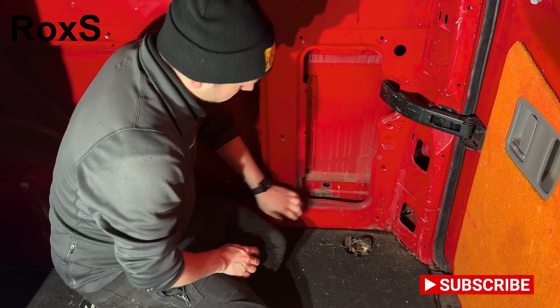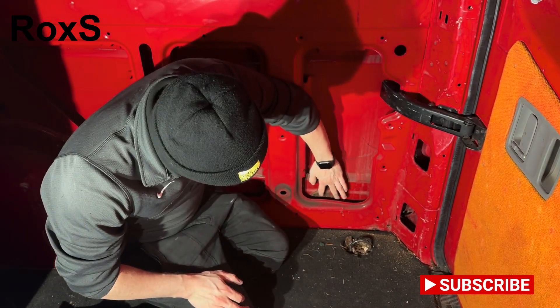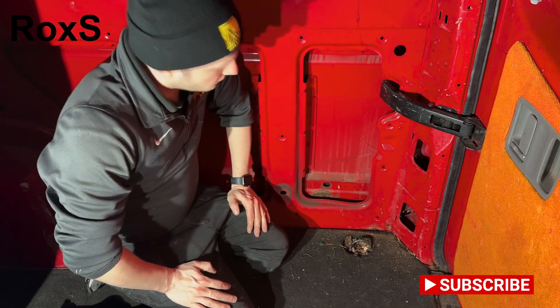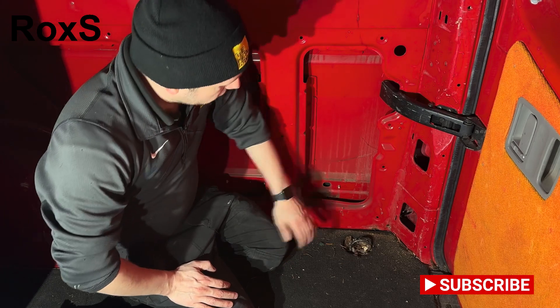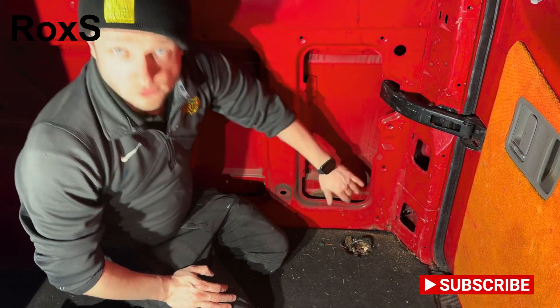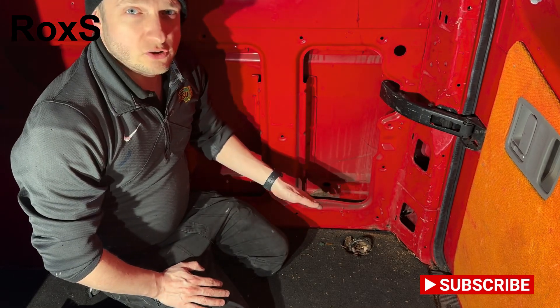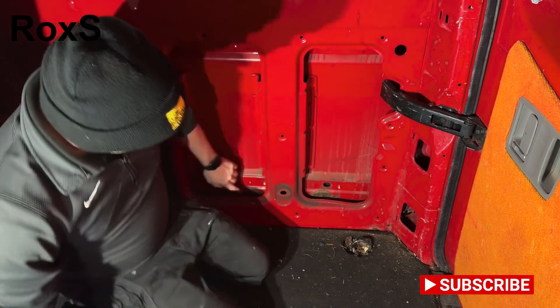So as you can see here we've got quite a big rust patch on the internal of the van. We're not yet on the sill — it's too wet to do any exterior work at the moment. So what I'm going to do just to try and treat this now is just rub it down and put some anti-rust paint on the external here, and there's also a bit here that I'm going to do the same too.